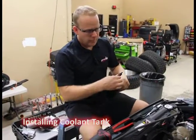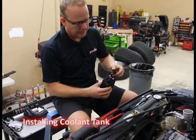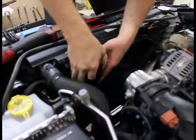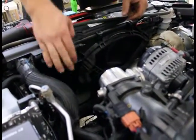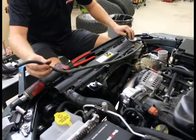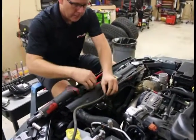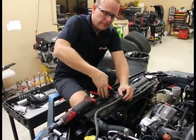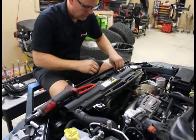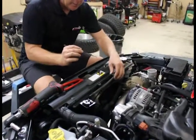We have our coolant tank provided — we installed the fitting, ready to go. I leave this on here a little bit, then install it here. We're just going to slide it on the top one, down on the side here — real simple, light push, it's not going anywhere. We have our factory hose coming from the radiator that went to the factory coolant tank. We'll install it here, see how it should look, route it, and simply cut it to fit. Slide it on the push fitting and tighten the fitting in just a minute.